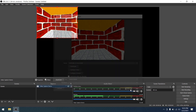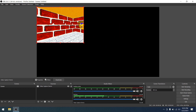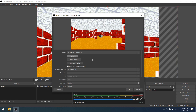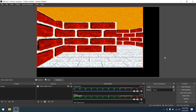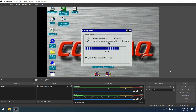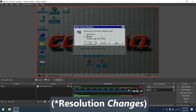Going back to the main screen, if you try to scale the image it doesn't work so well. We quickly learn that you want to go back into settings, hit Deactivate and then Activate — that sets the resolution properly. You can see we're a little over-scaled from the earlier adjustment, but we can now adjust down and get to that perfect 1920 by 1080 output. Now, flipping over to Windows 95 by exiting the screensaver, you can see the screen is all sorts of out of whack. This is one of the negatives about the VGA to USB LR — it takes a little while for the adjustment to kick in. If you're doing a lot of resolution changes, this may not be the capture device for you.